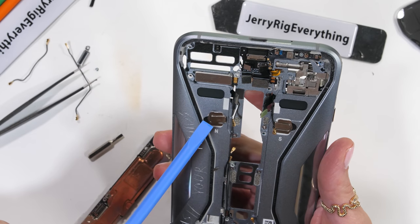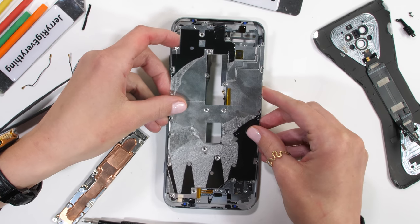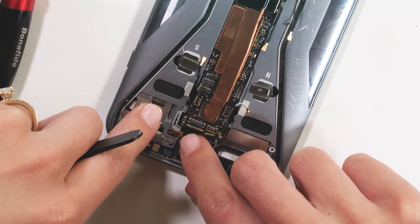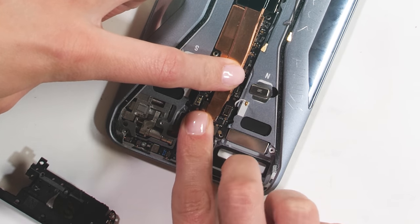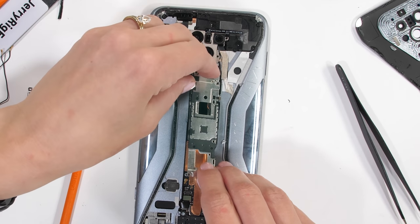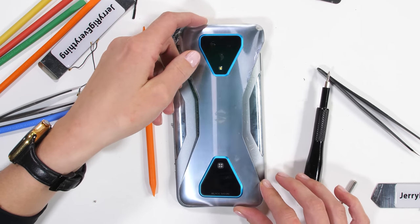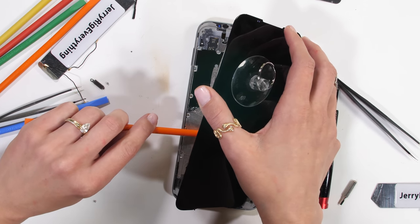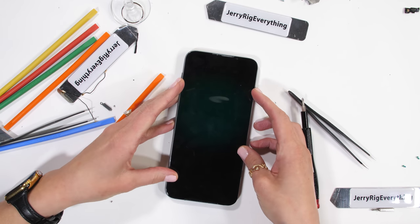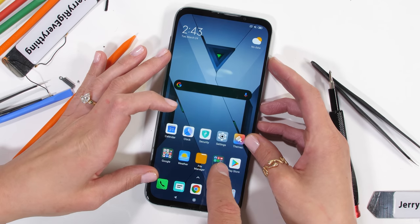Now that we've seen the insides, you should just play this video in reverse to see how it goes back together — just kidding, I'm not a quitter. I want our shark friend to live. 29 screws later, I can put the motherboard back into its cubby and gently place it back into the spine of the phone, and start reattaching the Sharknado of connectors. Then the bottom plastics go in, the top plastics get set down, along with the triple camera, and the metal plate over the top of the board to screw everything in tight. Then we take the back glass panel and plug the rear LED into the motherboard again. After we put the screen back on, I clip the last ribbon into the phone and remove the suction cup I forgot to take off. It's alive — I did not see that coming. Everything still works. The screen is on and functioning like normal, and I didn't have that many screws left over either.